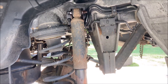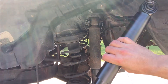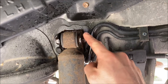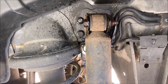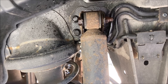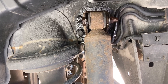This particular Pathfinder is a 2001. Note that the shock is mounted vertically. Earlier Pathfinders usually have their shocks angled in a diagonal fashion. The sizes of these nuts and bolt heads may vary, so what I call out in this example video may vary from what you have. The shock part number is likely the same whether it's vertical or diagonal.